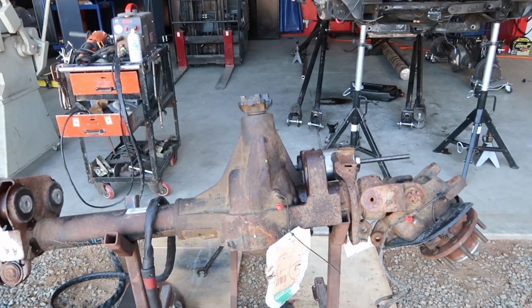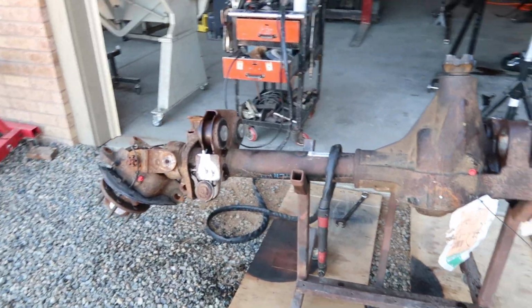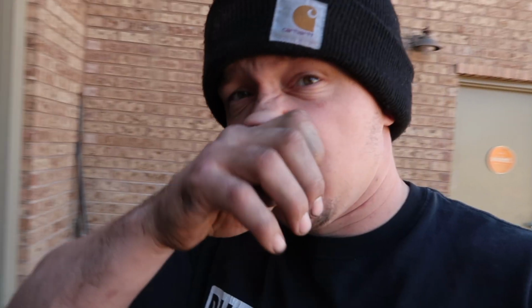We do need to order the powder and get everything all set up, but we will get this all taken care of. So this is kind of the main focus, is get these axles both 100% done, so that way we can actually put the truck on under its own weight. So we're not gonna powder coat everything at this moment, just the axles, because we kind of need the axles to be done to move it, and we don't want to go 10 steps forward and take 2 steps back and then go forward and back, because we need the spindles on to measure all our drag links and everything. So if we don't have the appropriate spindles on with the high steer knuckles, we can't take all our measurements, because we won't know where they're at.